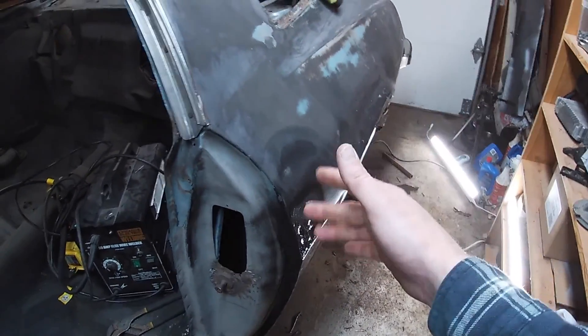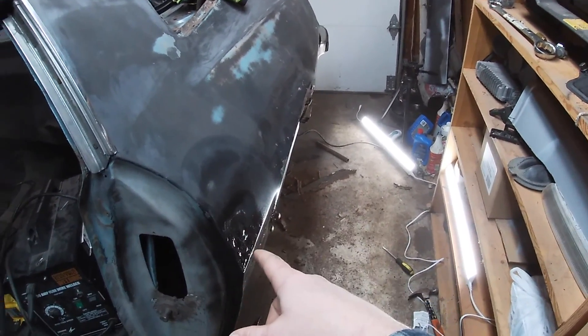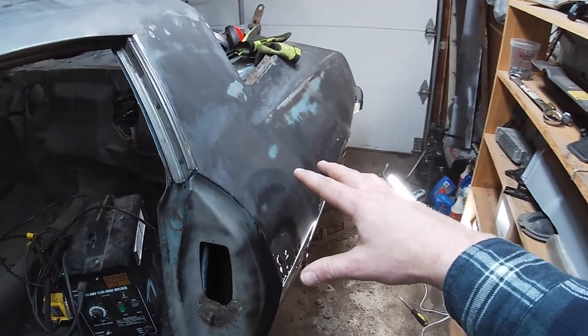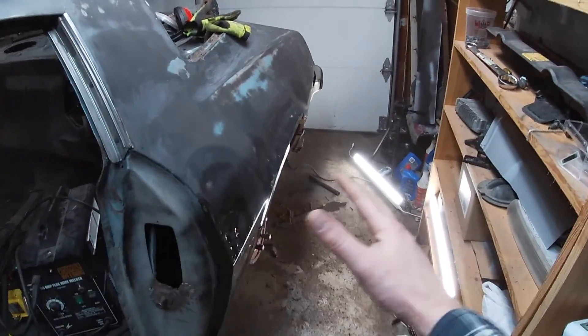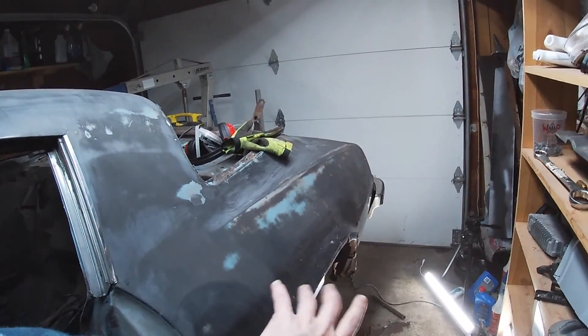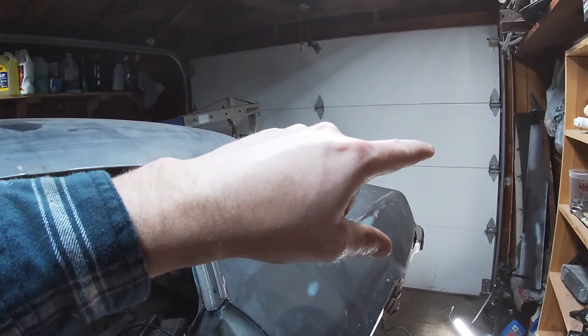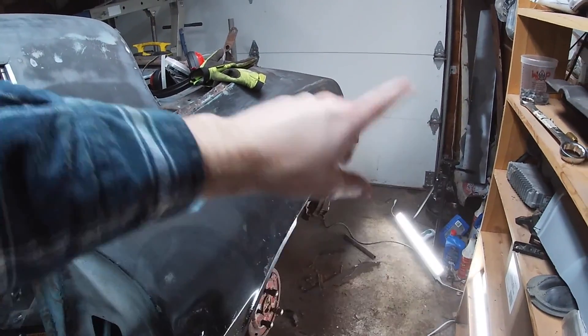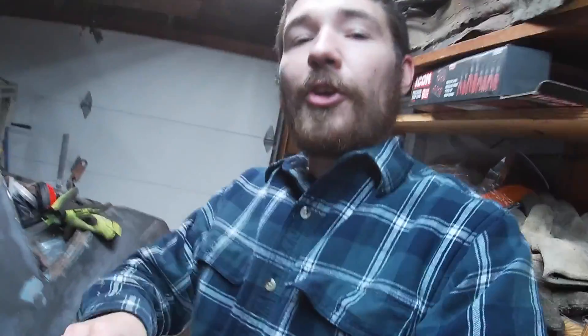All right guys, if you're wondering, we will end up sanding this all back down. This is just for preventative measures until we can get on the actual body filler and finish up all this area. Really, we want to get done with all the car's rust spots and everything like that, and then do all of the body filler all at one time. That way we know what's going on and can work from that point on. I think we're going to end it there for tonight. We have got a lot done on the quarter panel. We have some big holes, we know where we stand. We know we don't need any more parts besides that drop pan. We'll probably hold off on finishing all of this up until we get the drop pan in so we can get this all finished in at one time, because we can't do that back portion until we get the drop pan in first and then put on the outer skin. Hopefully you guys all enjoyed the video. Make sure to like, comment, and subscribe — it really helps out the channel. I want to thank you all for watching and I'll catch you guys in another video.